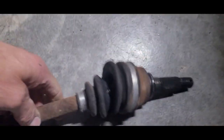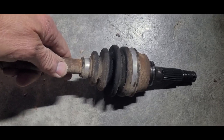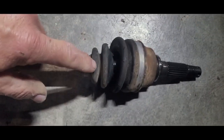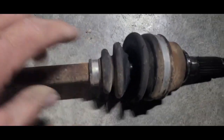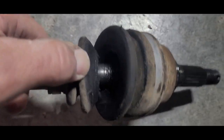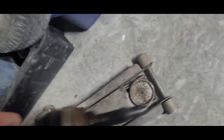This is a full front four-wheel drive axle I took off — see how it's cracked there? Even straight it might not look cracked, so check them closely. Notice how dark it is here versus lighter there — check that out. Make sure you don't have broken boots because it doesn't take long for dirt to get in and mess up the CVs and they'll start clicking.